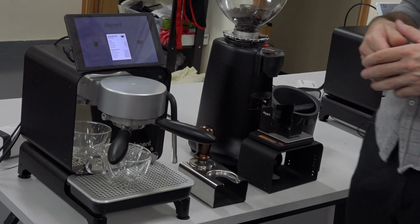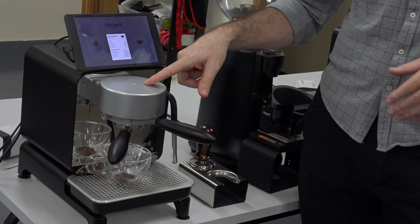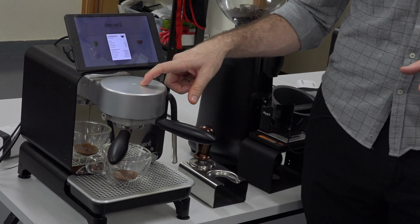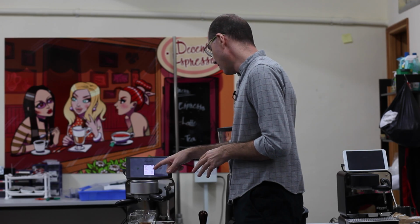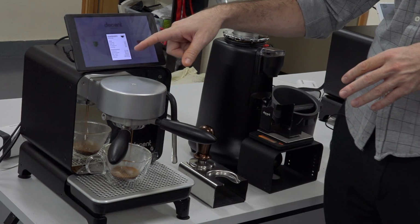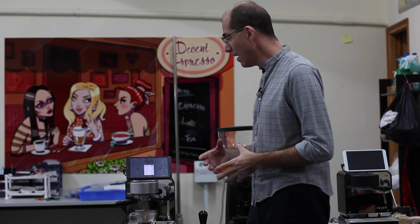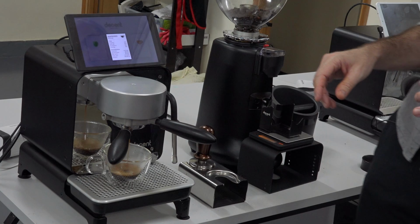It's just up the mix temperature because our DE1 Plus is aiming for a brew temperature of 90 degrees, not a water temperature. So it's automatically varying the mix temperature so that the temperature sensor here is trying to attain 90 degrees. And we're very close. We're at 89.5 degrees infusion temperature, and you can see that the mix temperature is actually 92 degrees. So what it's doing is compensating for the cooling effect of the coffee grounds, the basket, the portafilter, and it's a brand new way to think about coffee brewing. Instead of the boiler temperature, you're thinking about the infusion temperature.